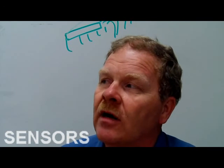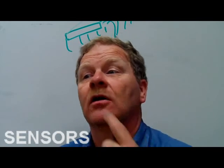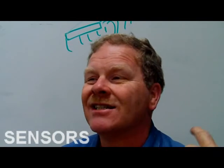You can test it by air. But let me ask you this: if I test it with a DVOM, do I know that it's good for sure? No, you need that. What if the solenoid is stuck on? What if the moving part on the inside of it is stuck?